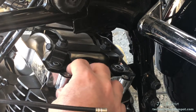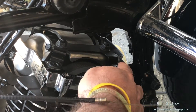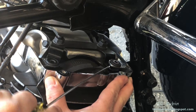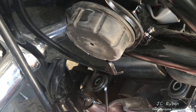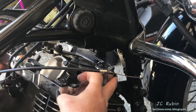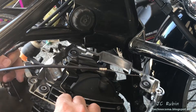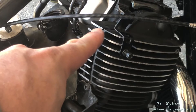I'll slide the cover out gently. These bolts up here are inhibited from coming out in any other direction, so it's down and out by the fuel filter. The front cover can now be lifted off - we do have to carefully pry off the rubber seals from the metal as they will be stuck. That covers the prerequisite work for the front valve covers.